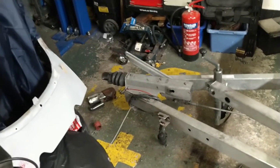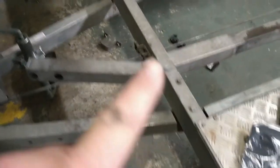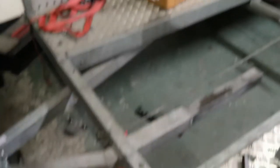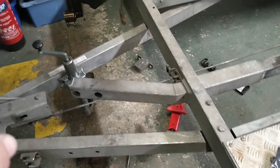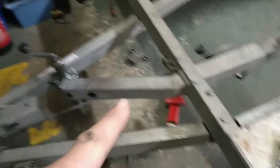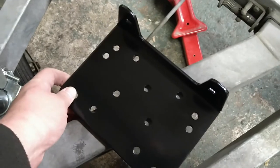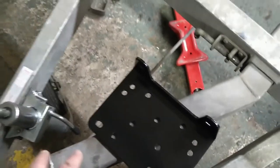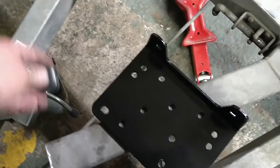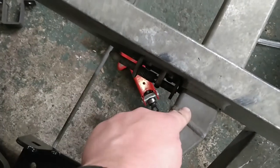That was a battle but I managed it in the end. I had to take the tow hitch off, the little plastic holder for the trailer socket, and undo those brackets there and also the other end of that rail underneath. Now I need to get it in the right position so it doesn't foul the jockey wheel handle. The winch mounts onto this plate here with a load of holes in it, so I'll have to figure out exactly where — parallel to that of course — then drill a couple of holes and this arm also needs a hole in it for the pin to stop it sliding backwards and forwards.